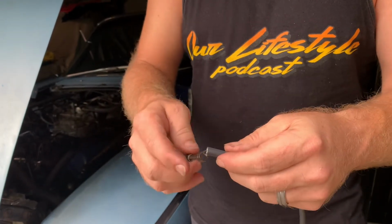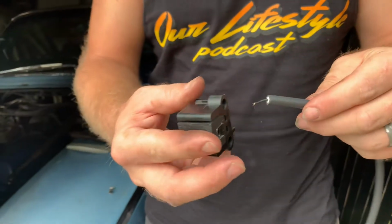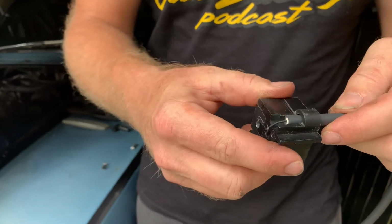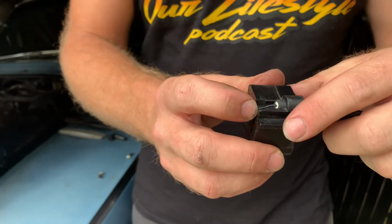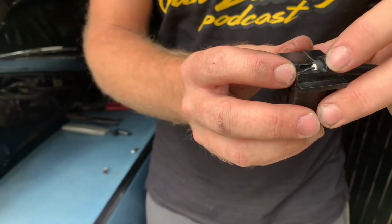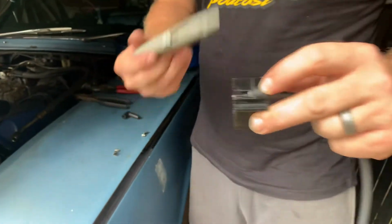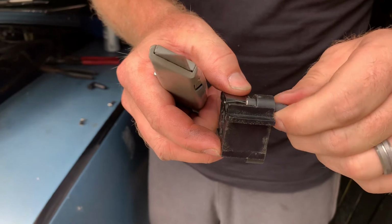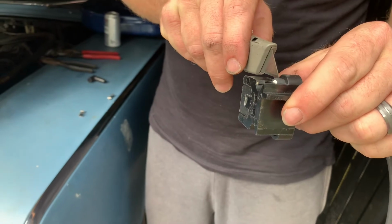Once you cut it to length, you put it into the same little MSD tool. You stick it into this; there's two different sides, and I think one might be a tad bigger, but they're about the same to me. What I had figured out with the actual ends is that if I put the little wire right to the very edge of this on my tool bench, I knew I needed to cut to about right there with the razor blade. So I would hold the razor blade right here and twist this back and forth with one hand. You just do a couple rotations and it's basically going to have that where it's cut.